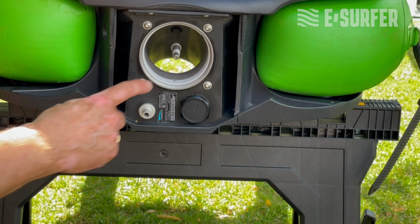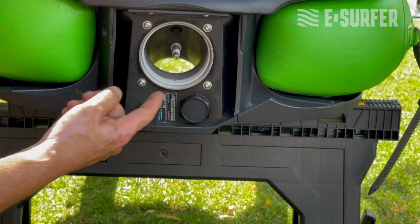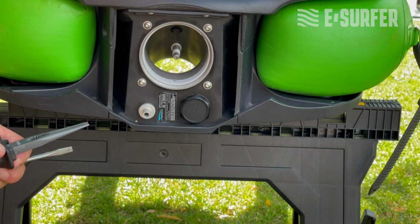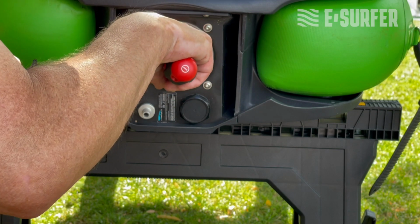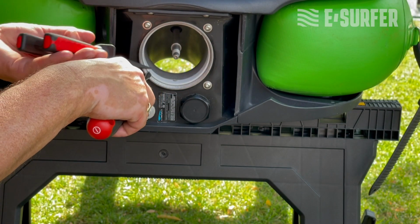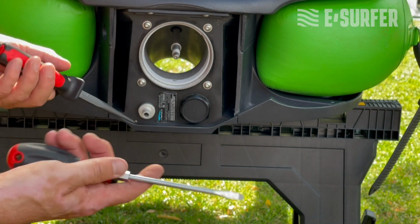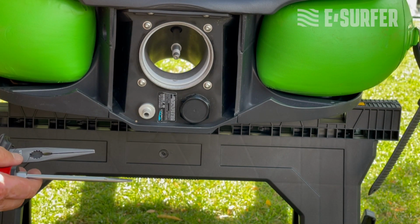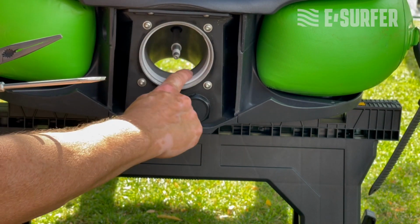In the next step, we will look at the wear ring if there's any defect. If there's a defect, we will change it. If not, we just leave it as it is. If you need to change it, you need a screwdriver and a tool like this, and then you just do something like this and take it out. It may break, but that's fine, it's damaged anyway, so you have a new one in your impeller set. I will leave mine inside because this one is still good enough.